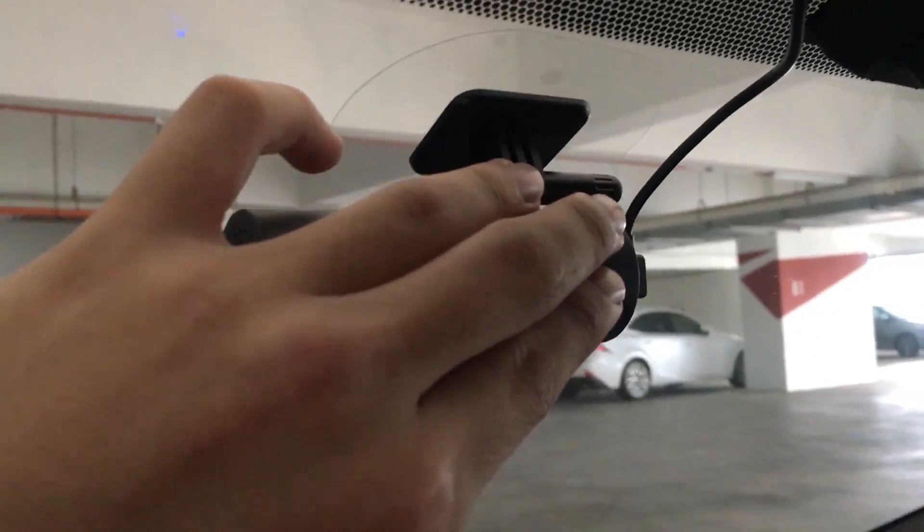So what you're going to do is this — all cars have it. Once you plug it in here at the power socket, you just move it all the way up here. There's a gap between the ceiling and the inner lining — there's actually a small hole here, enough for you to push your wire in. I've rerouted the wire, inserting it all the way in here. You just push it in here, here, here, here. When it comes to the corner, you can see this gap — you just push the wire in. The plastic is hard but the lining is soft, so you just push the wire in and slide it along.